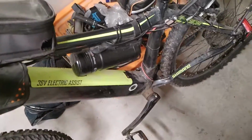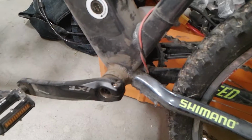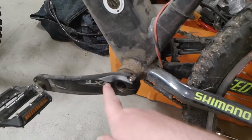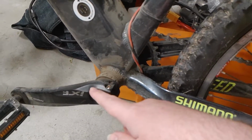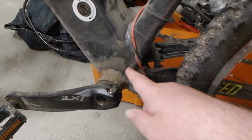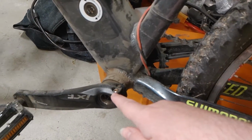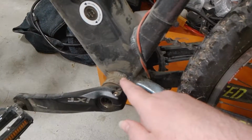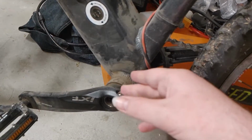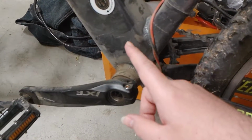And if you're still wondering, yes, I am still trying to figure out a mid-drive. But mid-drives cost around 500 bucks, so they're quite pricey to buy right now. I've also been going back and forth on whether to go with the Hollowtech system like this, or just use the integrated system. The integrated system has a much smoother bearing system than the Hollowtech system does. It's not as smooth going, but you do have less flex inside the frame with the Hollowtech, because it's more out and squeezes the middle much better. But I'm still deciding what to do.